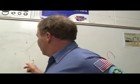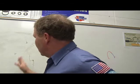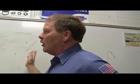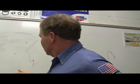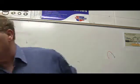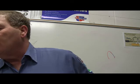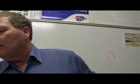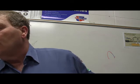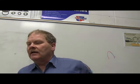If you short this to ground and you're testing that bimetal gauge, most of these bimetal gauges have what you call an instrument voltage regulator to keep from getting burned up in case you wind up with an issue where you've got a short to ground or something. All right. But anyway, in a bimetallic gauge, the bimetal strip moves the needle by way of a magnetic field. That is absolutely false. It does not move by a magnetic field. The third one, an instrument voltage regulator, delivers regulated voltage to the gauge circuit.